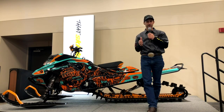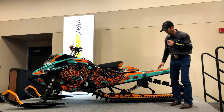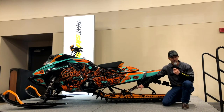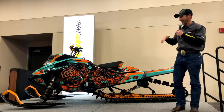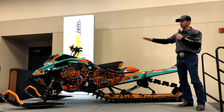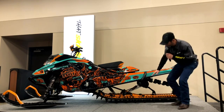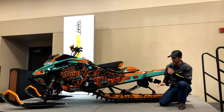How do I control ski lift? The ski lift control comes from my rear suspension setup. In order to keep the skis on the snow or near the snow, I have to have a stronger torsion spring — a much stronger torsion spring. So when I'm on the throttle accelerating up the hill, the weight of the sled transfers back and is applied to the rear suspension mechanism, and it will squat the sled — it will collapse the spring.